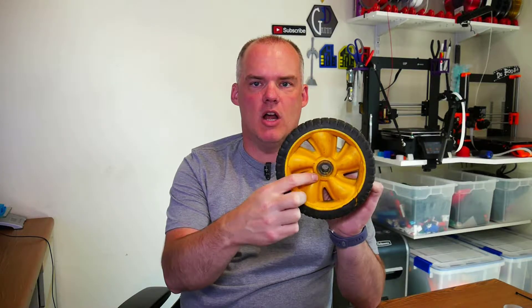Here's one of the smaller front wheels from my lawnmower. One of the problems I've had with the wheels lately is the pivot — basically this plastic with a little bit of grease runs directly on an axle bolt. This plastic is actually wearing out so that when you spin the wheel, it toggles back and forth. As you're running down the lawn, it twists side to side and you can actually feel that it creates a little bit of extra drag on the lawnmower, making it harder to push. This is not a self-propelled lawnmower at all — it's a human-propelled lawnmower and it's a pretty cheap one that I got a long, long time ago.